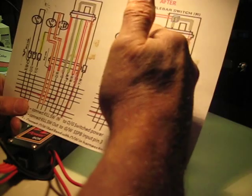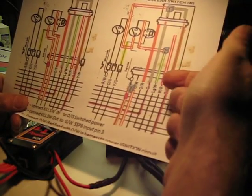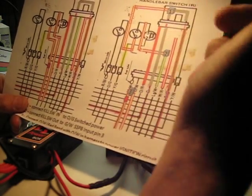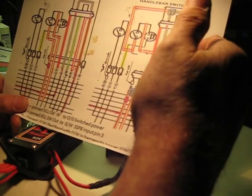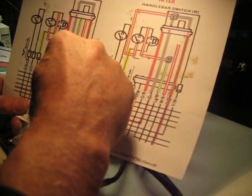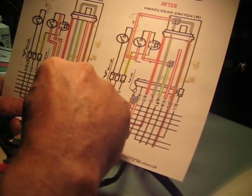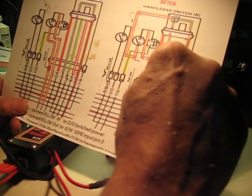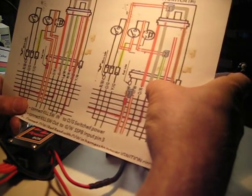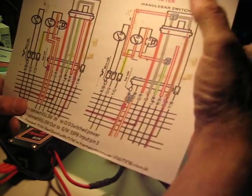Now the other wire, which is the output of the kill switch, needs to be routed back to the solid-state power box, and as we mentioned before, we're going to use that spare light green-white wire. So that second connection is to the light green-white, which has now been cut. You'll notice the light green-white going through a loop to the white with a red stripe. They've been cut, and the orange-white output of the kill switch is now connected to the light green-white, so it can go back, and the white-red is available.